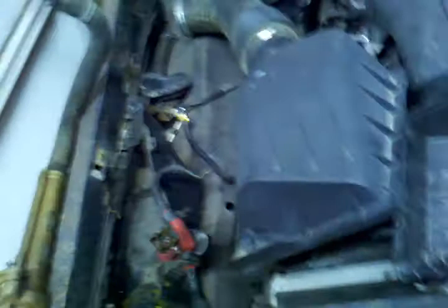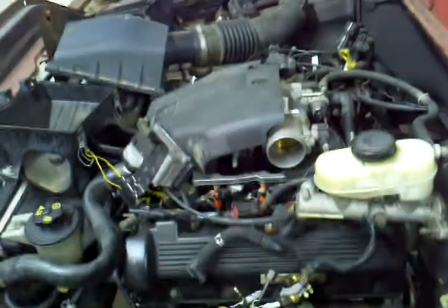It's around here somewhere, but anyway, it's like a little weird plastic box. I don't know what it does, other than there's a vacuum line going to it. It has nothing else plugged into it or coming from it. So my guess is some kind of a charcoal evap canister that just soaks up gasoline fumes or whatever that are in your intake. I really don't know. Right now it's been totally eliminated, so unless I throw a check engine light for it, it stays out. My guess is, like Amir says, any leftover nuts, bolts, parts, brackets, just over-engineering.